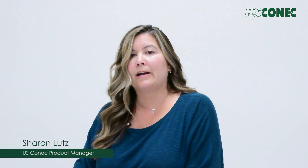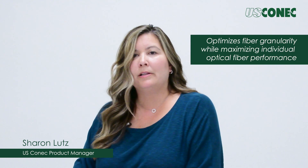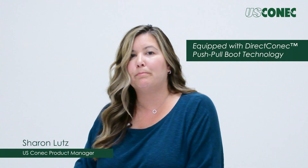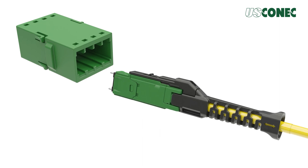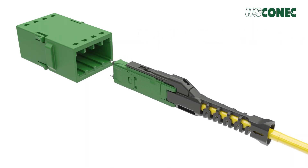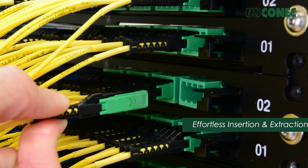The very small form factor connector embodiment optimizes fiber granularity while maximizing individual optical fiber performance components versus other multi-fiber connectors. MMC connectors are equipped with Direct Connect push-pull boots to assist with accessing individual connectors in highly dense cabling environments. Direct Connect push-pull technology uses the boot to activate the latch, eliminating the space needed at the panel for finger access.